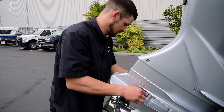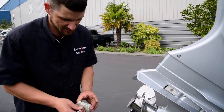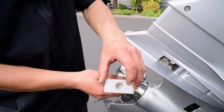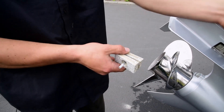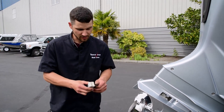There's the nut — take the bolt out. Here's one side. Now these go in one way. There's a thicker side here, which goes towards the front of the motor, and then there's a thinner side on these Hondas. So I'll grab new zincs and we'll put new ones on.